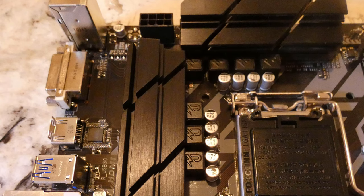For CPU power, this is a 2x4 connector, so if you're buying a power supply make sure you have that. There are some cheaper 500-watt PSUs out there that only have a single connector, and you'll end up having to get another power supply. Of course it also has HD audio and USB 2.0 connectors as you would expect.